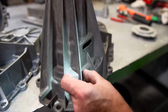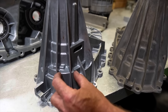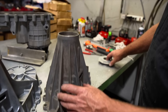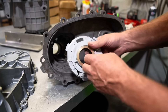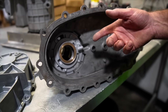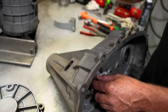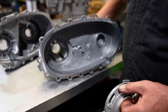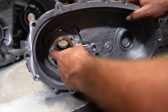You can see here's the pump rub area where they're notorious for rubbing through — this is on a factory mag rear. If you bring the camera over, you'll see what we have on ours — it's way heavier duty, way more area. Knowing this is mag, you're going to have wear issues inside this case from the pump rattling in there; you're going to eventually knock holes through as it vibrates. Does the case saver plate prevent that? Absolutely. But nothing prevents the snap ring groove from wearing out and taking out that fork. So we get rid of the soft mag housing and go to the heavy aluminum housing — aluminum housing, aluminum pump, and the pump will not cut through.